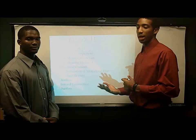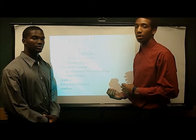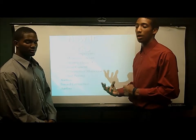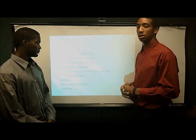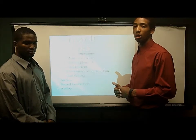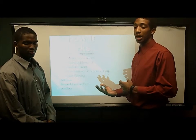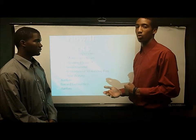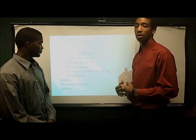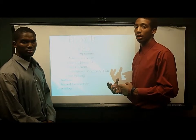The electrical circuit comes into play when you plug the product into the outlet. The power cord is plugged into a wall and the circuitry draws current from the wall into the product. But the product cannot work unless the on switch is activated, which closes the circuit and allows the current to be dispersed throughout the appliance. As the current is dispersed, there's a knob that determines the speed setting you want. The slow setting allows the fan to rotate at a slow rate and produce less powerful heat, while the higher rate causes the fan to rotate much faster. The electrical wiring is connected to the nichrome, which allows it to heat up. As the fan circulates the air, it flows over the nichrome wiring and forced convection occurs.